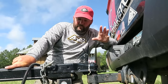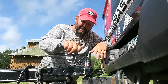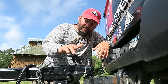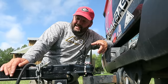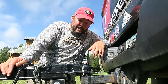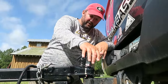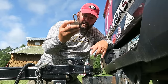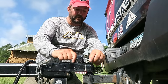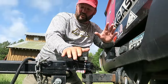A few things I've learned from my own mistakes: make sure you lock this thing down. I once left the dealership — Buck's Island Marine — with my boat, got about a mile down the road and thought 'did I drop the latch?' I hadn't. I quickly pulled into a parking lot and dropped and locked it. Got into a conversation and totally forgot to do it. Luckily the trailer didn't fall off the truck. So you latch this down, then use a lock — you can buy a specific coupler lock or just use a cheap Master Lock — go right through here and latch it. There's no way this is going to pop up on bumpy roads.